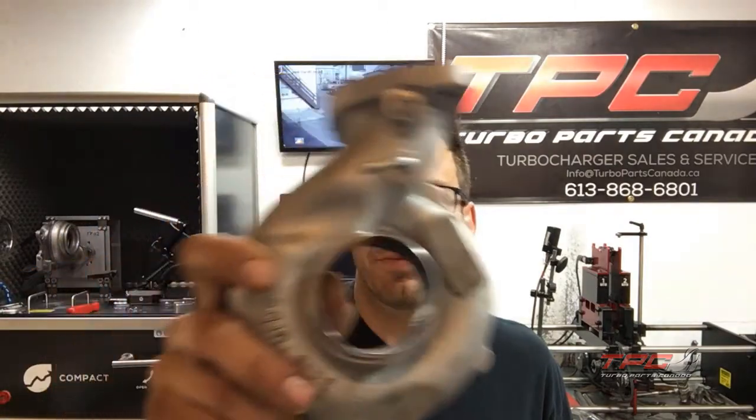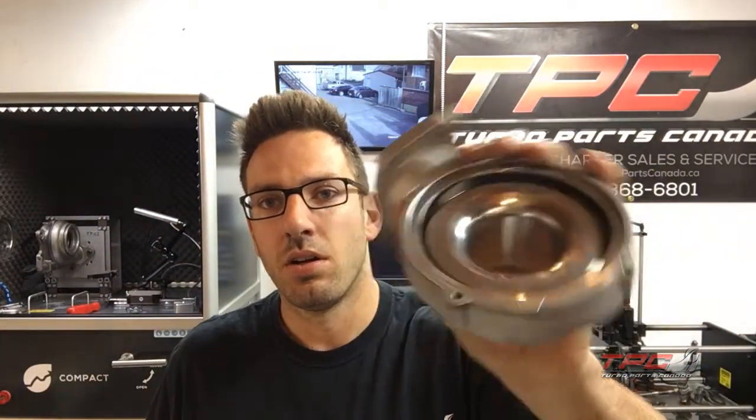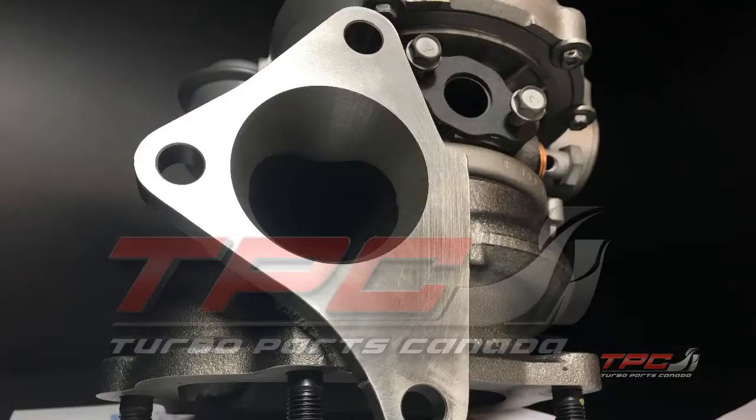Not a lot of people know this, but we do the same upgrade on the VF-52s as well. All machined out, polished, ready to rock — upgraded wastegate, upgraded turbine — everything available for the 52 also. That's the biggest and baddest you can do to the stock IHI turbo. The VF-37 is a twin scroll and we can upgrade that too — it has the same components as the VF-39, 43, 48, and 52.